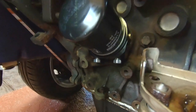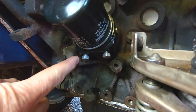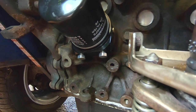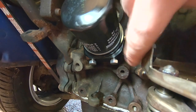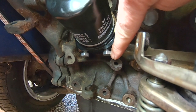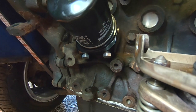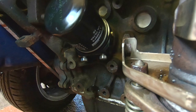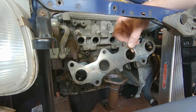The other thing to be aware of is where your lines are going to be coming out of. I only really need one line to come out of this, so I'm probably going to take this one on the left because it's the most clear. You can swing this around a bit, but the exit on the side here would end up pointing up underneath the manifold and it'll get pretty hot there — there isn't a huge amount of clearance. And if you're trying to screw in a pressure sender or something for a gauge, that's going to rub on the big protrusion on the block as well. So far at least one of the ports looks usable.